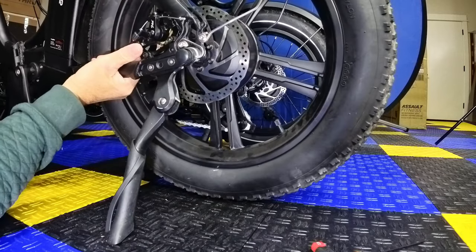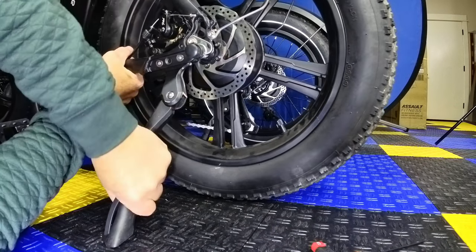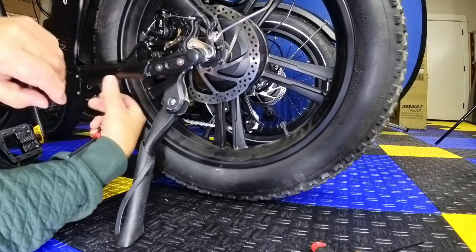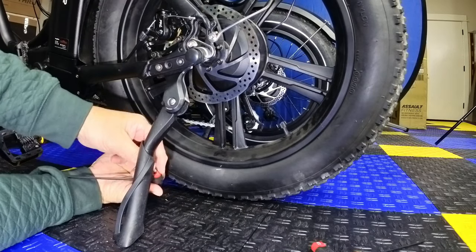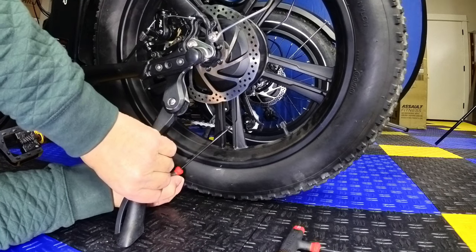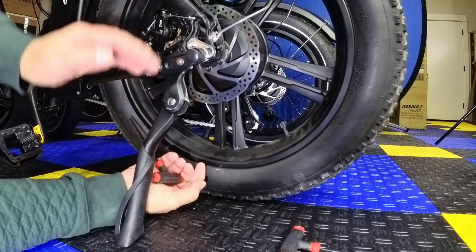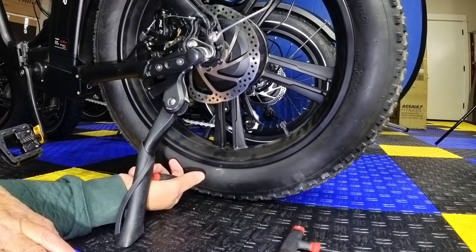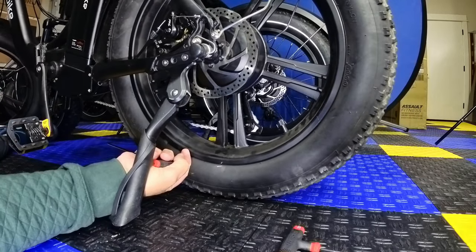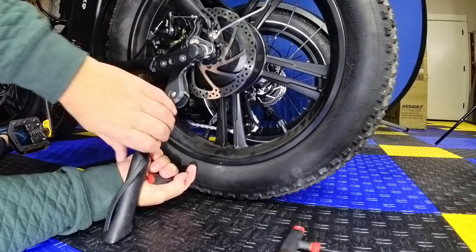So that's done. Now the only other thing I have to adjust is what do I want my lean on my bike to be? So right now that's a pretty heavy lean. Do I want it to be more straight up or more leaned over? I don't think I want mine that far leaned over, but what I'm going to do is come in here and get it close to tight, then tighten it back up. What's happening is this screw here is probably a little loose for some people — it just might not be tightened, so theirs is leaning over and flopping off all the time. In my case it doesn't do that. So what I'm going to do is put my feet up here, hold the bike where I want it, pull this down — and I like about that much lean. That's good to me.